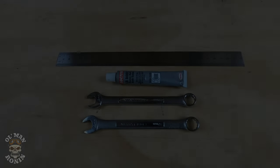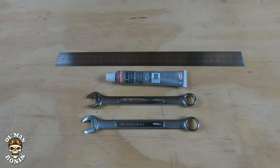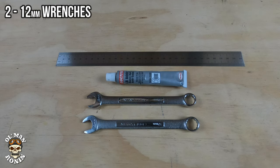That is the clutch free play. We did a video on the Himalayan clutch free play and adjustment and we're getting ready to do one on the Meteor because it's a little different. Tools needed for this operation are super simple: you need two 12 millimeter wrenches, some anti-seize, and a measuring device. That's it — easy peasy.